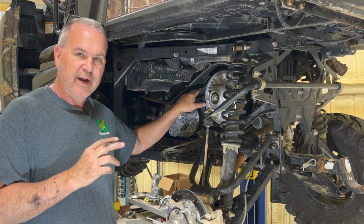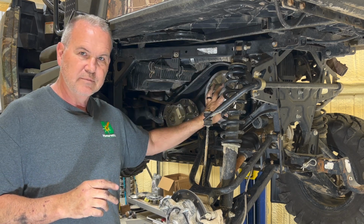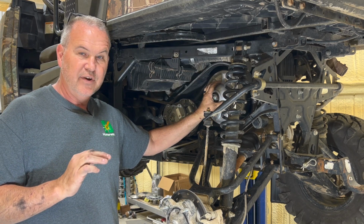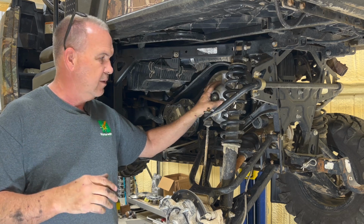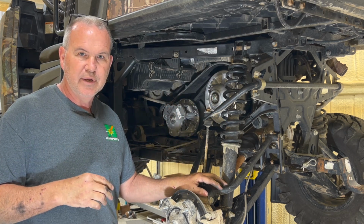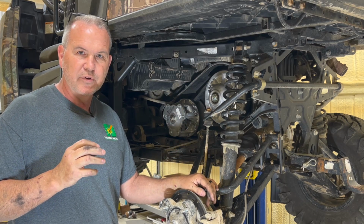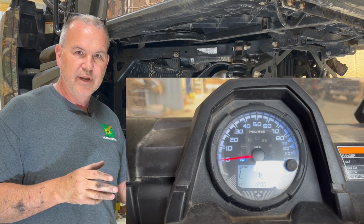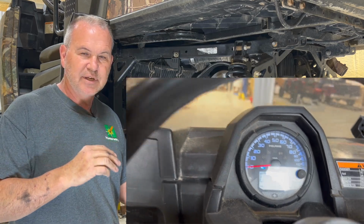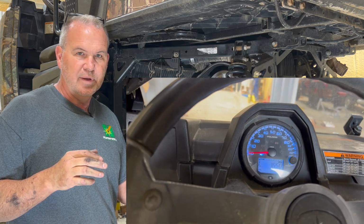We've been using our 92G on stock clutches for a long time, but once you move to this better upgraded secondary that's very quiet, you can go to a thicker belt, grabs better. Got a little video here where we were just pulling in during some testing phase and looking at exactly how slow you could drive in low with it fully engaged, and we were, as you can see, going 0 miles an hour at roughly 1800 RPM.